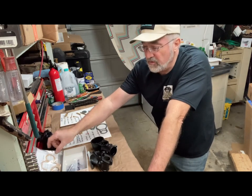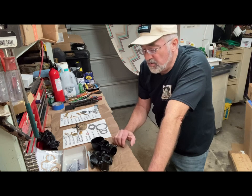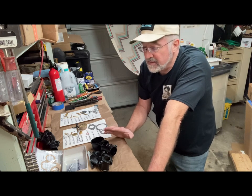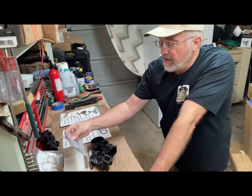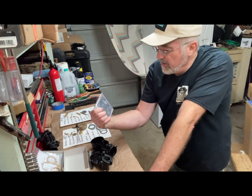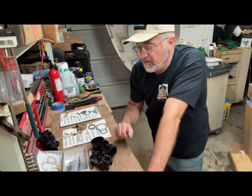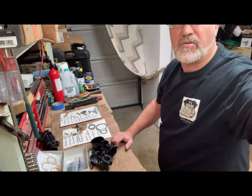They're even more difficult. And there are some specialty carburetor places that I may be able to get some more parts from, like floats. And I could always make do and make some gaskets from gasket material, but some stuff like the jets and the floats, you know, this Marvel kit has gaskets in it, but it doesn't have any of the jets. So that was just a side note for the aftermarket crowd.